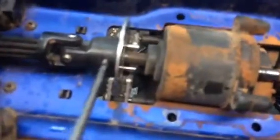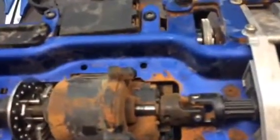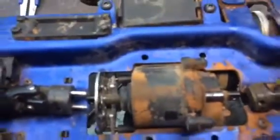And then you'll take a 2.0, I believe this is a 2.0 wrench, and you'll loosen these set screws. Okay, you loosen the set screws on the yoke, set those aside somewhere safe. There's also another one in this hole right back here for this back shaft. Once you have those two removed, set them aside with all the rest of your stuff, then you just slide that out and slide that out, and now all the wrenching on the bottom is completed.